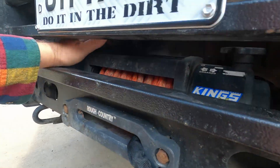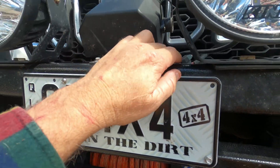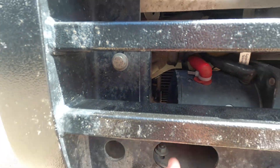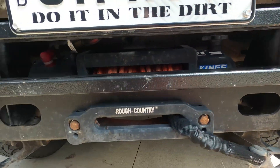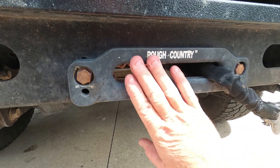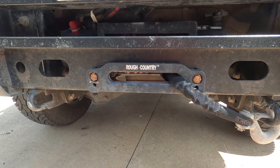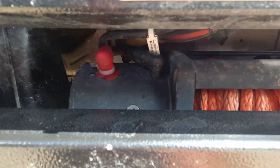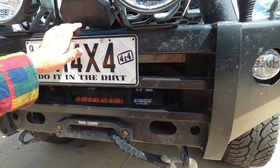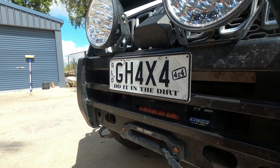It is as simple as that: the cradle comes out, goes down, winch goes up, cradle goes back in, sit the winch on it and bolt it up. Then just tuck your wires up through here — I've got mine run up through there, out of my box up on top, just screwed into the top of the bull bar. Run your wires in through your grill to your battery. As you can see, the winch fits in there with plenty of room around it, and you can get your hands in to put it on free spool and drag your cable out. The fairlead bolts up to these fellas here.